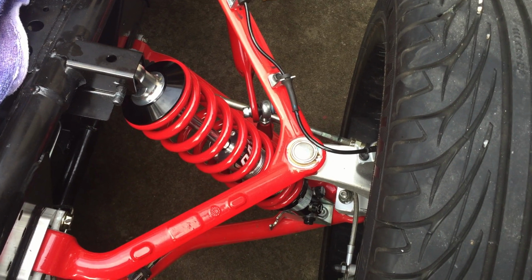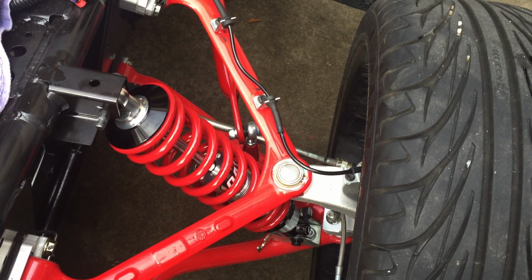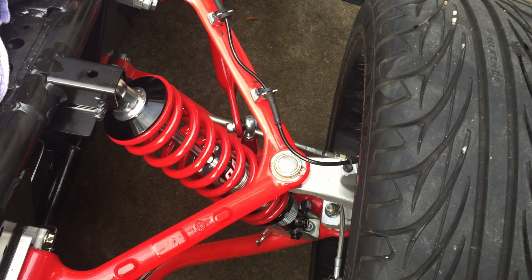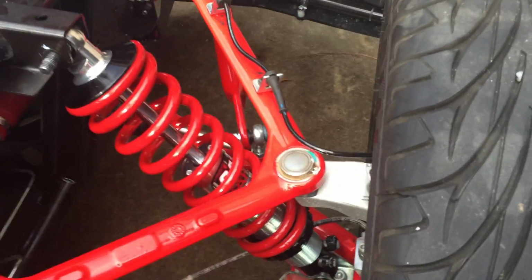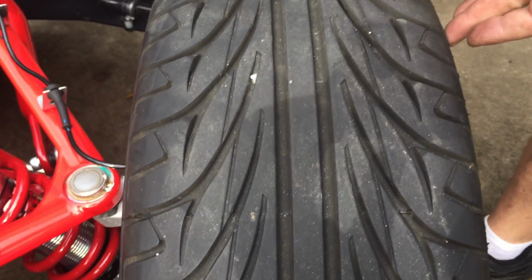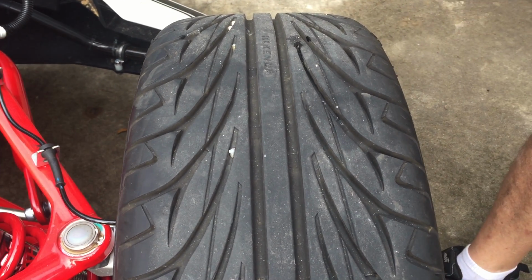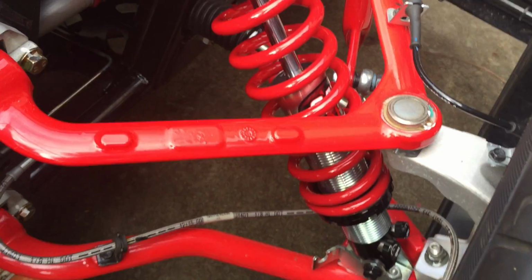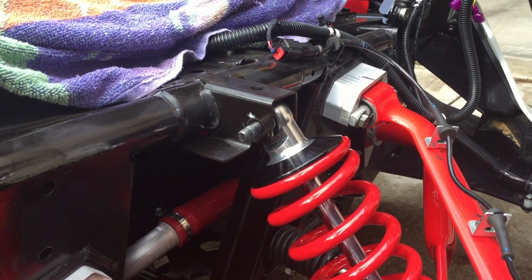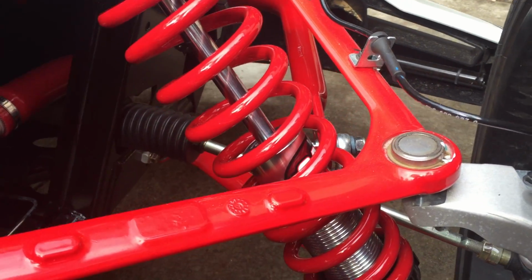One, any change in height of the front suspension or rear suspension will require a couple of extra things to look at. In the front, it is alignment. When we lower the front end to any degree from stock, we actually create more camber, which brings the top of the front wheel in, and we also change toe a bit, in that the toe becomes slightly more toed in. Now, do you need to realign? Only if you're going to put like 20,000 miles on your Slingshot a year.